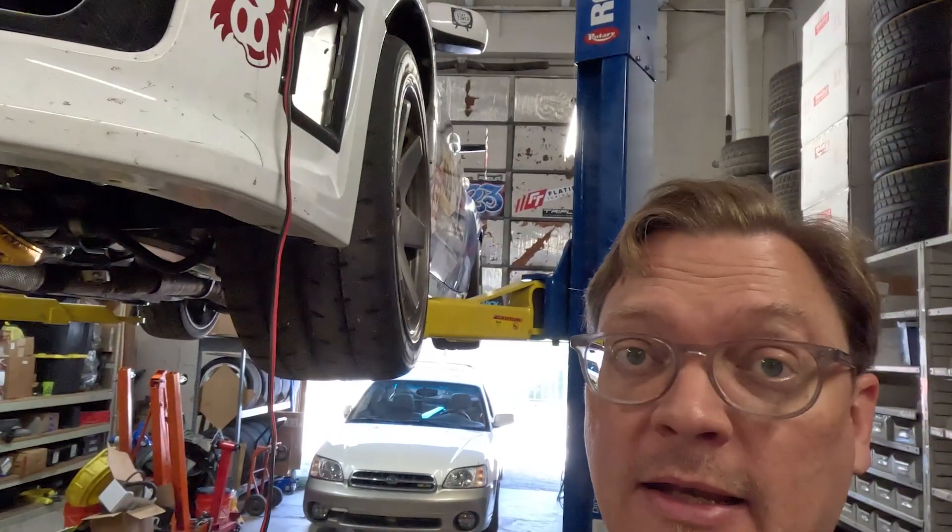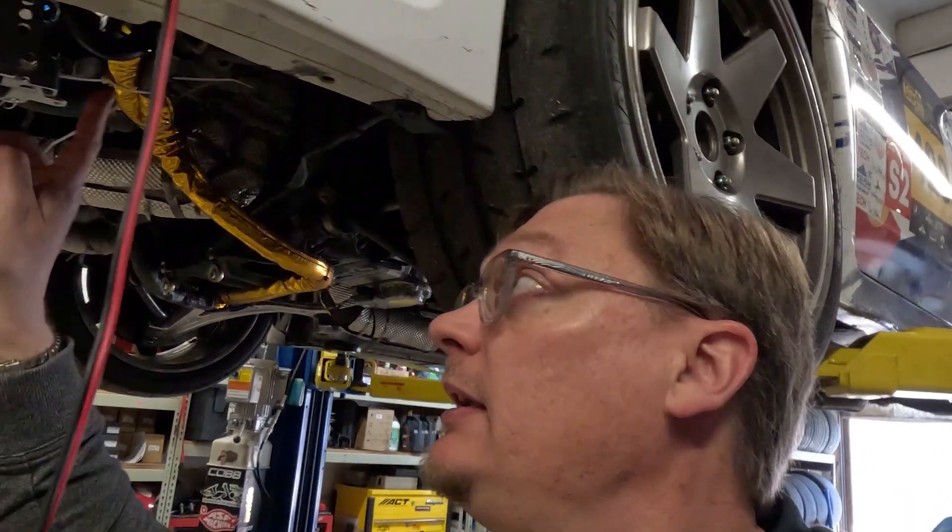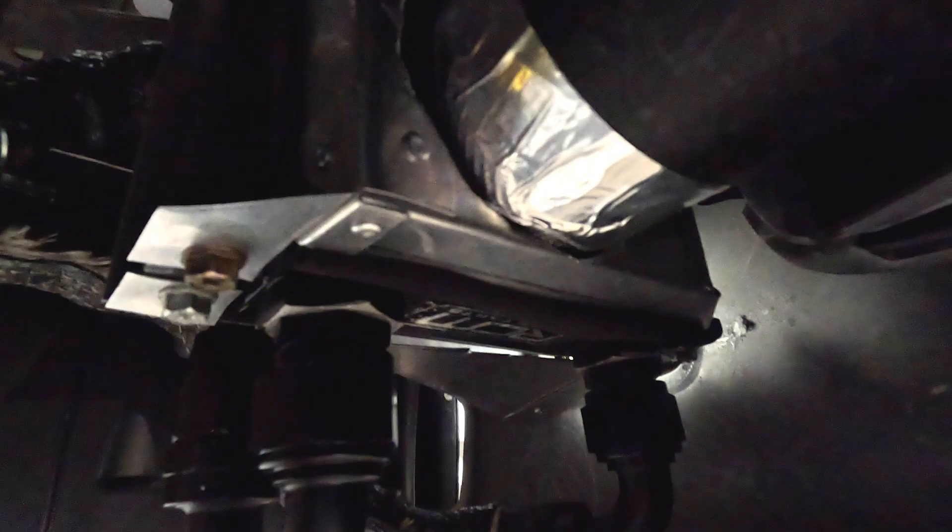So what we've done is we've definitely put our fender liners back on, because we want to keep that air contained in the wheel well. But we've also made some big changes to the placement of our oil cooler. Now this brake inlet duct is solely used to grab air and send it through the oil cooler, which we've repositioned here. This is a much more effective, much more ducted use of that oil cooler, so that should really improve things there.